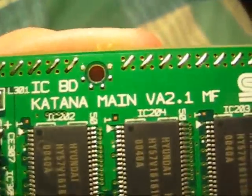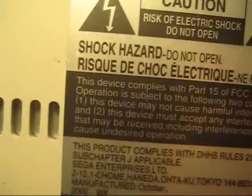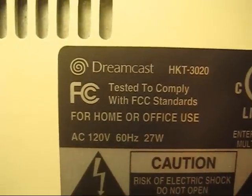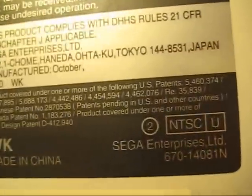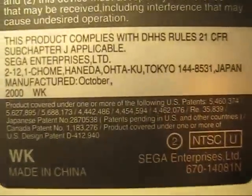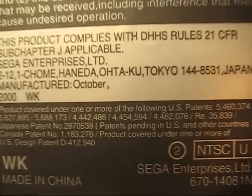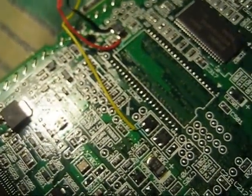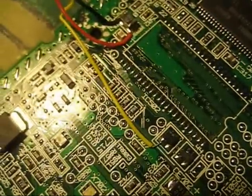Like I said, this is version 2.1 or whatever — looks a little bit different than the other version. And on the back it says a 2. I always thought maybe the 2s didn't read backups, but this one seems to read backups just fine, at least the few that I tried. There's a different way of doing that first track — there's a way to burn Dreamcast games so that they will run on any Dreamcast. Some people say certain versions won't run backups, but that's not true. There's just a specific way it has to be burned, and a lot of the self-boot ISOs and DiskJuggler files just aren't up-to-date.